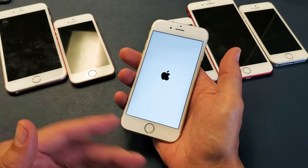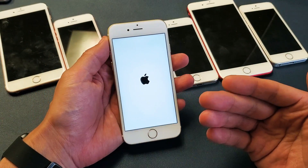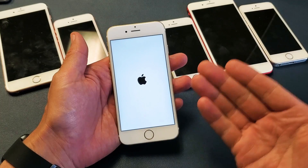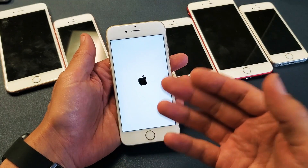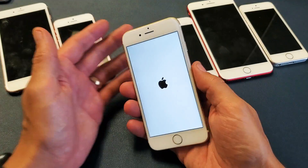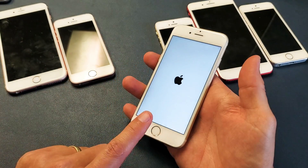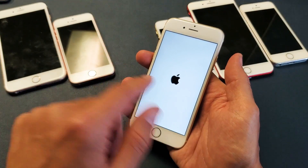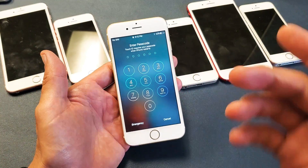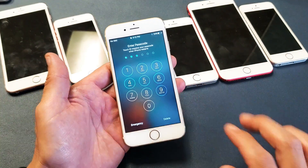Go ahead and let go. After it is done with the boot process, you guys should be up and running. Now, if you're not, sometimes you do have to do this same thing — this force restart — two or three more times. So again, remember, it's the home button, power button. Press and hold both buttons at the same time. Do not let go until you see the Apple logo appear, and then you should be up and running. Good luck, guys.